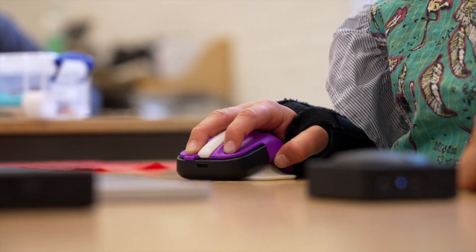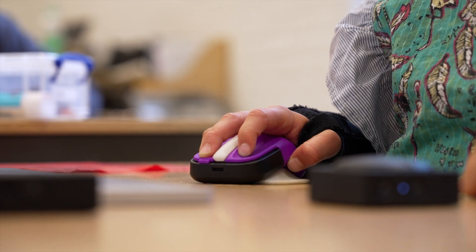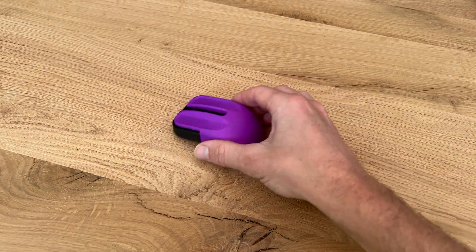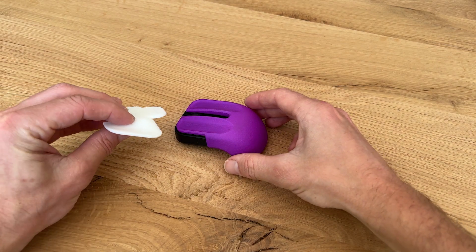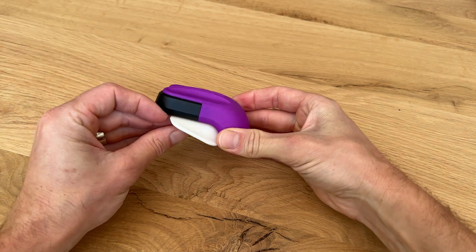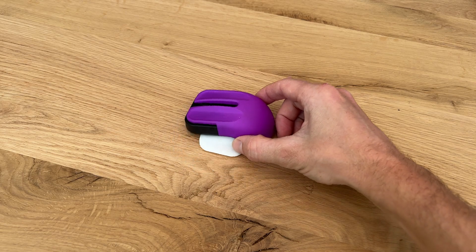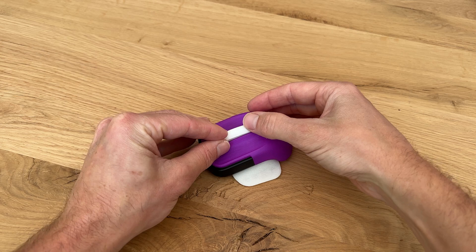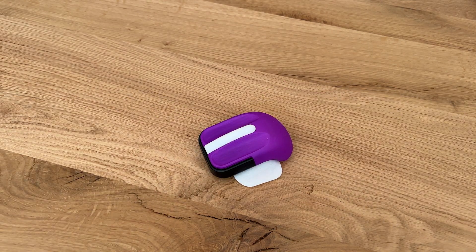In addition, it also slightly increases the force required to actuate the mouse buttons, creating a dampening effect. Next, we insert a softer thumb support that not only provides a comfortable rest for her thumb, but also creates friction with the table surface to reduce the impact of her involuntary movements. Finally, she uses a little 3D printed insert to cover the scroll wheel and provide further guidance for her fingers.